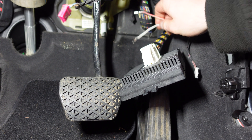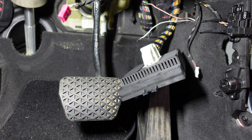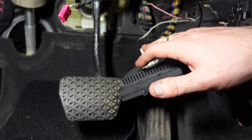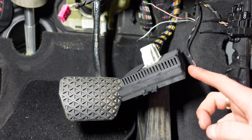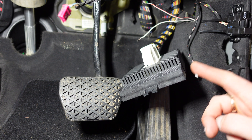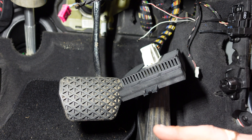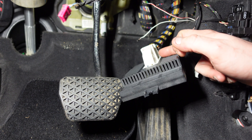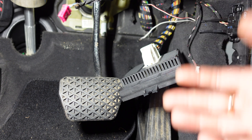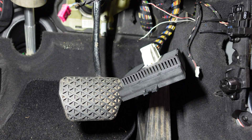If you can see here we've got two pins. I did the LCI retrofit previously, but this isn't really about the LCI retrofit as such — this is going to be showing you how to swap the pins, and that's all you have to do on this module to make it work. These two pins are responsible for the Angel Eyes coming on; they won't work with the LCI lights, but if you switch these over on your normal headlights you'll gain this feature, because these two pins are needed for the LM2.